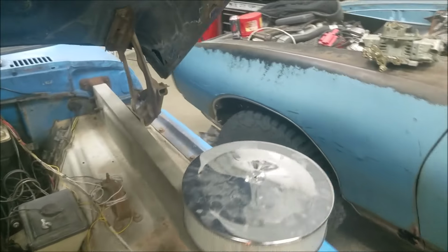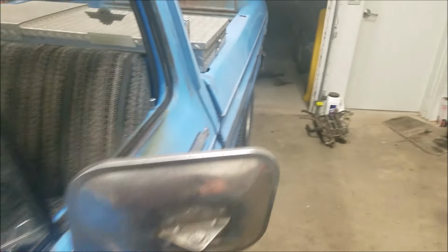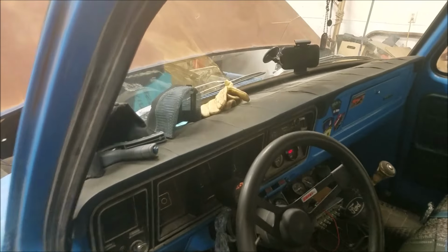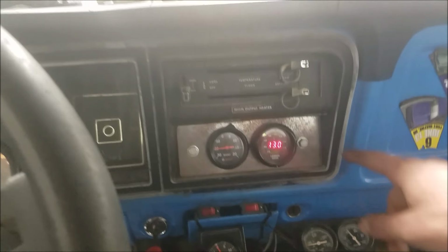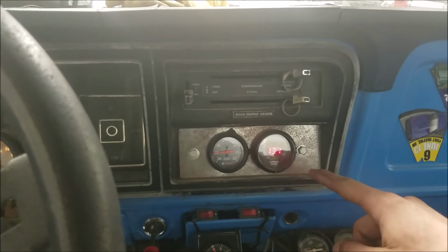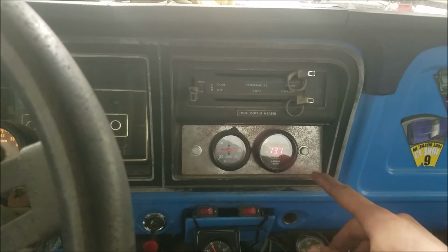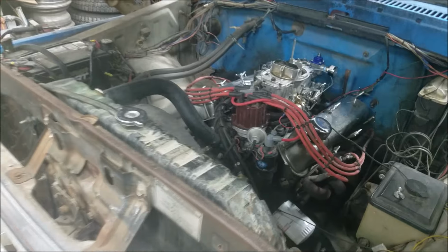Obviously, three-quarters of the sight glass is notably higher. You look at our air-fuel ratio. The exhaust tone of the truck has definitely changed. It's almost more gurgly in a way. It looks like our air-fuel ratio, from boosting our fuel pressure, has dropped a full point down to the low 13s, upper 12s, all the way from about 14.5.